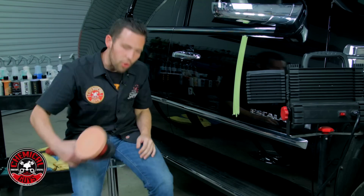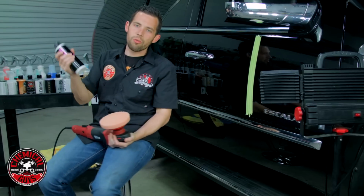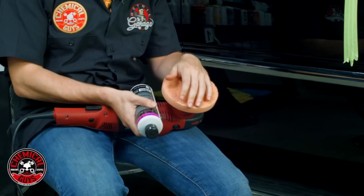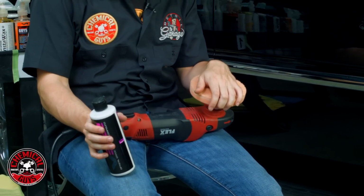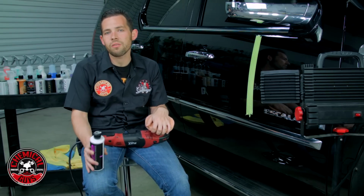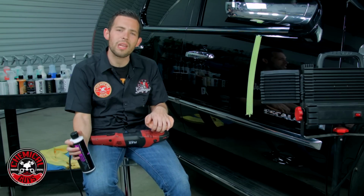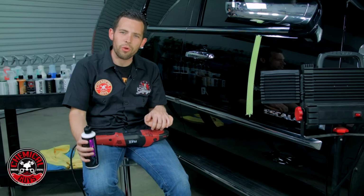Now I'm going to use a rotary polisher for this job, and I'm going to first start out with V32. Now when I did my test spot, I used V36 and an orange pad to test. That polish did not cut enough for this hard paint, so I stepped it up to V34. Now V34 produced results, but it did not produce enough results that I wanted to see. So I went ahead and used V32. Now V32 is going to cut hard enough, and it's going to remove all the deeper scratches before the refining